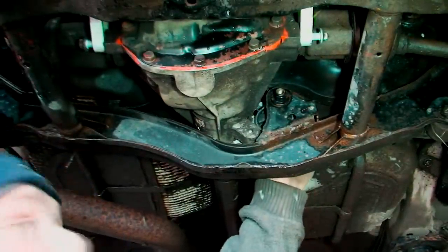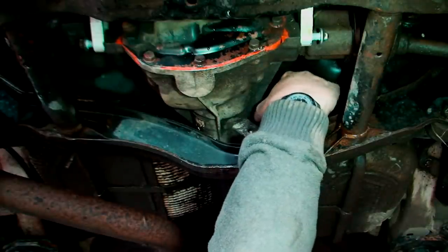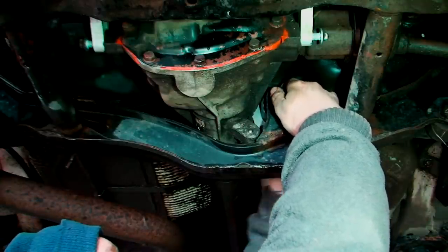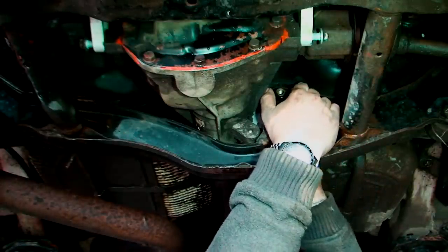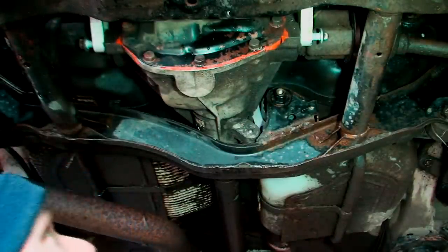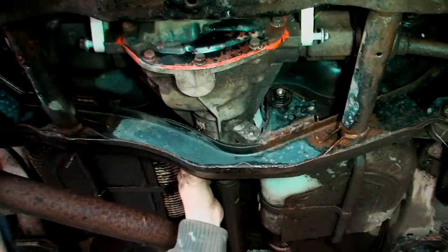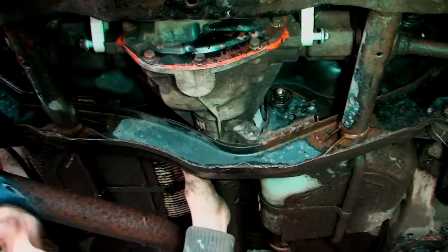Now this is the front bushing. Same again, I'm going to put the big bolt in first. Line the big bolt up, pull it through — just by hand. Even though the back bolts are in, we're still about half an inch off from the front. So you can see how much we can still move it. This is why it's important not to tighten anything yet, because if you tighten them the rubber will allow it to bend slightly but all you're doing is putting pressure on the rubber, which means the bushing is going to go a lot quicker.